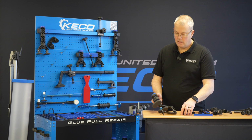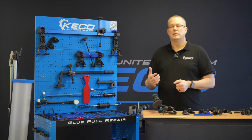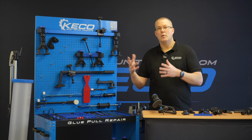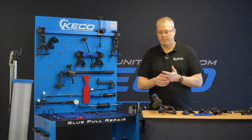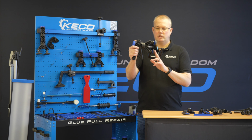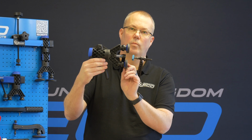So if we have something with a particularly sizable crown, so the wing's taken a piece of damage, we've got a body line in it and needs restoring, obviously it's a hard area to work, especially if it's aluminum or aluminium. And you're working at the front of the wing, and there may be a lot of flex in that wing. As we start repairing it, we run a high risk of blowing that arch line out. So what this does, this enables us to support the wing edge. The panel's going to sit in like this, okay? So this foot is going to sit right on the wing edge. This foot can sit on the crown itself.